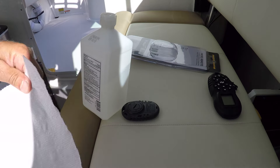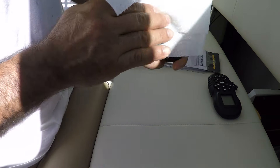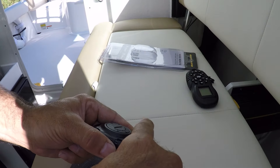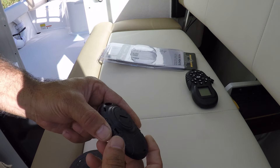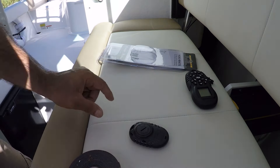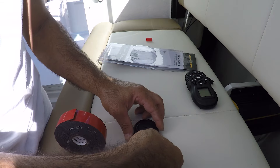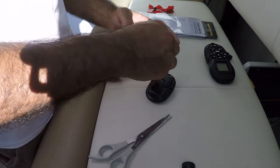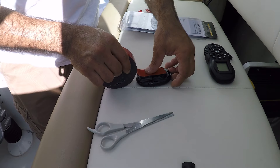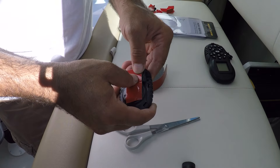First, I'm going to get a napkin and some alcohol and clean around the remote so the 3M two-way tape gets a good grip on the unit, and also clean the dash area for a good bond. I'm going to put a bunch of layers of two-way tape on the remote and one layer on the dash, so that in the future when I need to change the battery, I can remove it by just peeling the tape on that side. Now I'm placing one long layer all the way across, and since it's flexible it will squish to the dash and get a good grip.